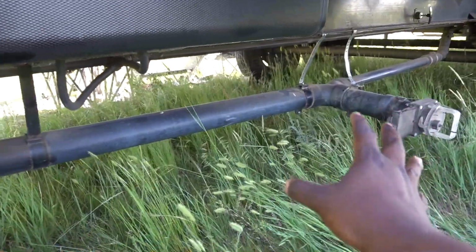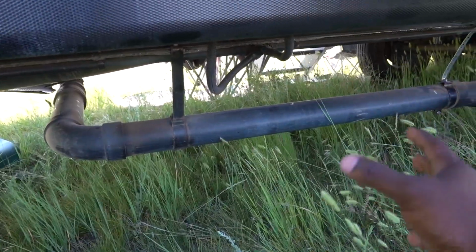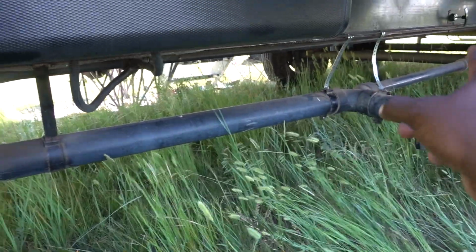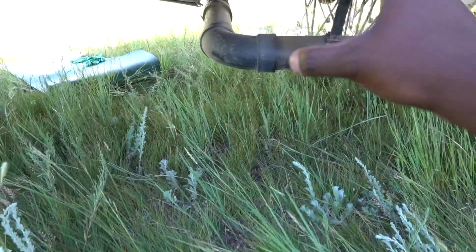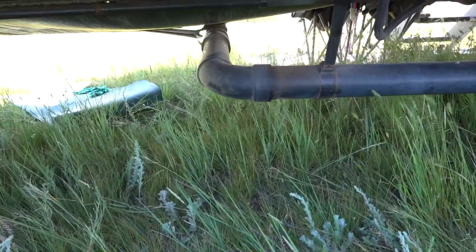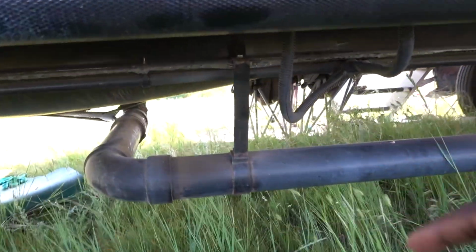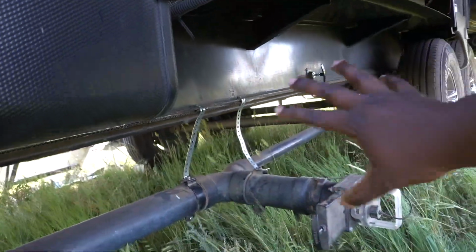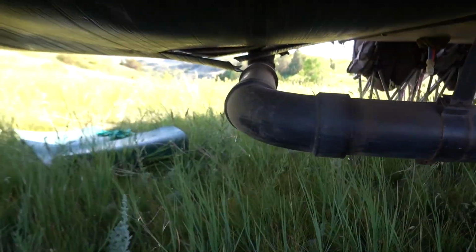And what's gonna happen is, if you ever have any issues with your valves while you're traveling, all you have to do is undo this coupler and that coupler, and then move this pipe out of the way. Because he says it's a lot harder for you to move around in there because it's just so tight. There's not a lot of space. So once you move this pipe out of the way, because as you guys can see, you have it mounted here, and then there's 3 other spots that it's mounted on. Once you move this out of the way, you have more flexibility inside.